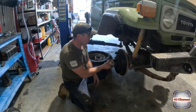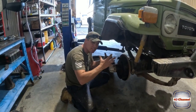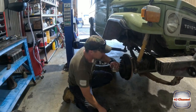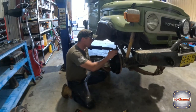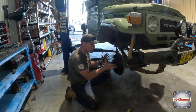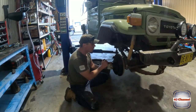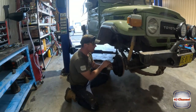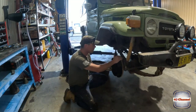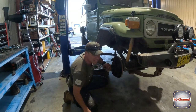We did a water crossing on the long drive — hit your brakes, nothing happens. You've really got to pump it, squeeze all that water out, warm it back up again before you've got any brakes. Not the best thing in the world, but they served pretty well for 50-odd years. A little bit of persuasion to pull that off — don't be afraid to get in there and pry it off. Sometimes you can even release the brakes just by winding it back in. These are all pretty much brand new from before we went away — we've got about 5,000 k's on them.